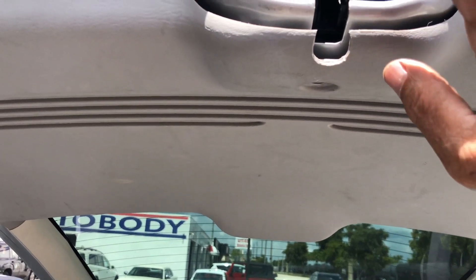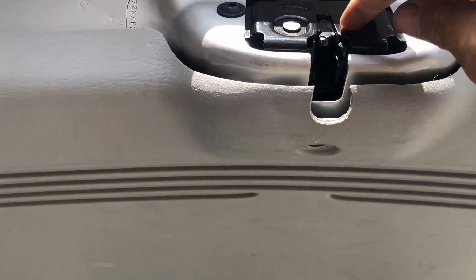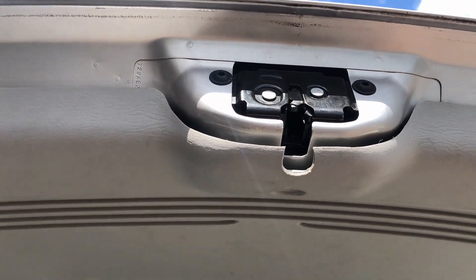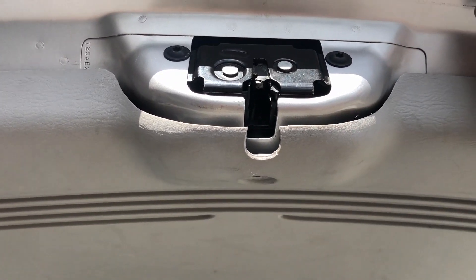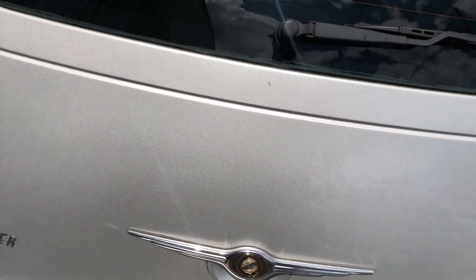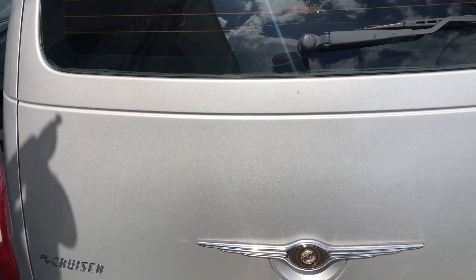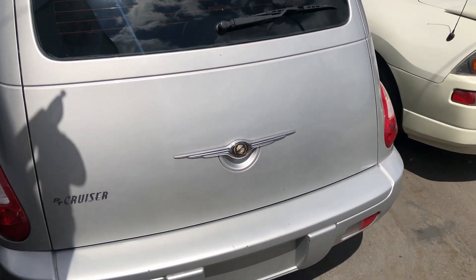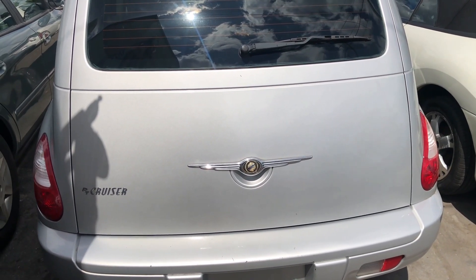If it is the actuator, it's only two bolts — not a big deal. You have to get it at the junkyard if you can find a 2009 or 2010, because the rest of the PT Cruisers do not have this electric door opener for the back trunk lid. Alright, I hope this video helped out. If it did, please subscribe — that's how we support the channel. Got any questions? I'm not a professional, but if I feel confident I can answer them, I will. Take it easy, guys.